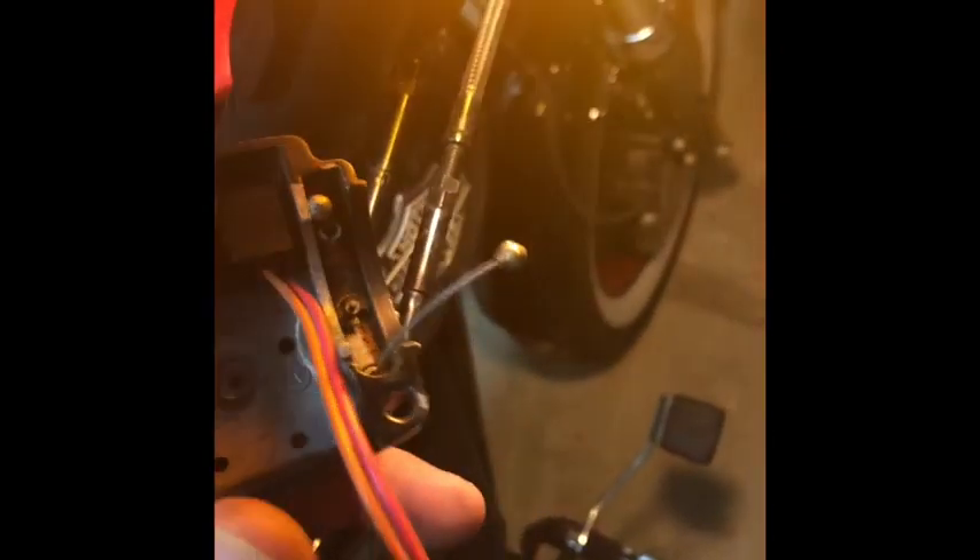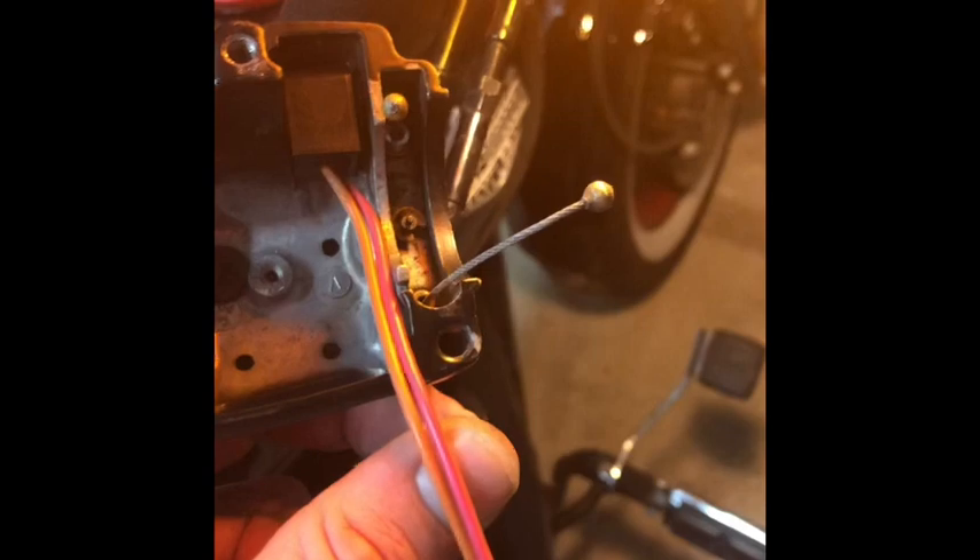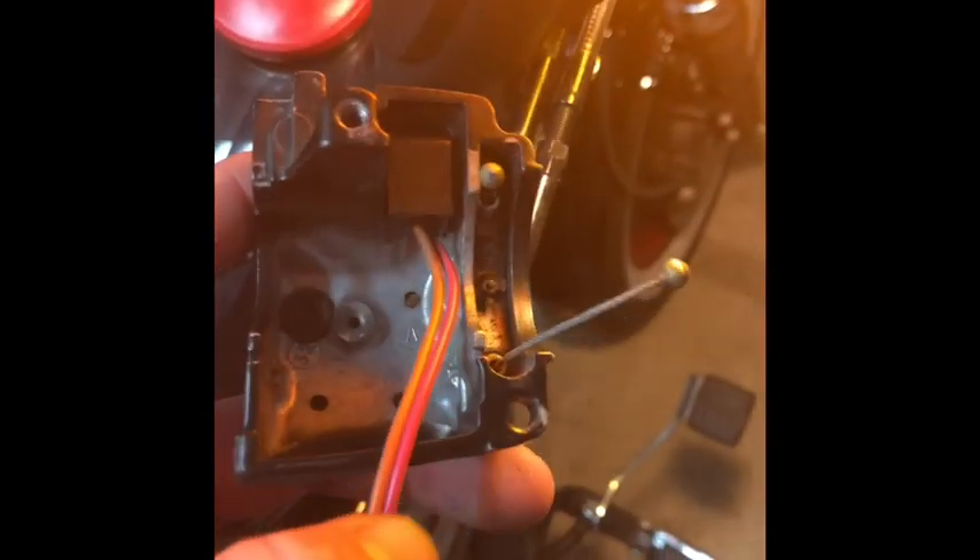I left plenty of wiring here, so I've got a little bit of slack up here on these. These are the wires I'm going to use to solder in — plenty of slack here. Obviously you have to cut some of this back, but always leave yourself a little extra, because when you go to solder, line everything up first and then go to solder. That way you have plenty of room and it's not too short and you're not yanking on it the entire time. So I'm going to get this soldered up and then I'll be back.